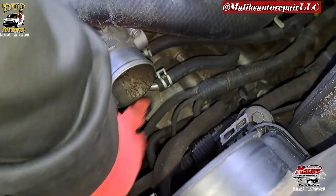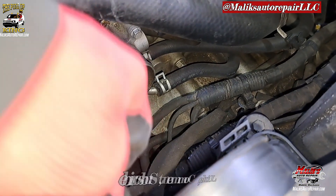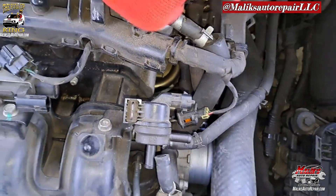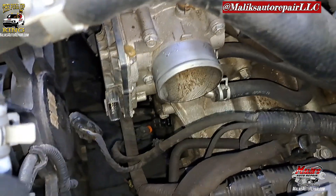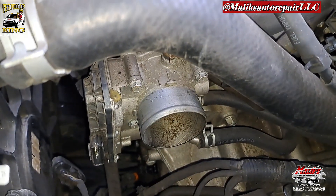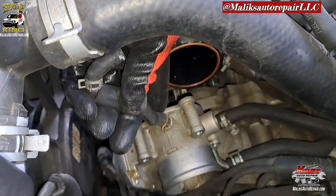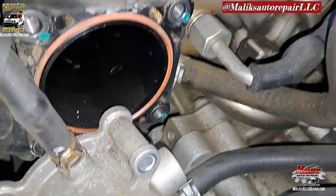See we got some coolant lines attached to the throttle body — I hate that. This thing probably needs to be cleaned, carbon build up. Got another hose. So we're going to have to try to take it out from here. Now we can work on anything else. Probably going to have to take off the throttle body, because these coolant lines are connected to it. I'd hate for any coolant to come out, so that's the best way. Four 10mm bolts. Pulling that throttle body up — now we can move it out the way.